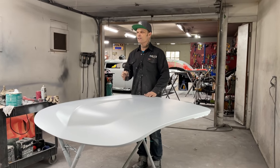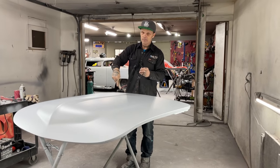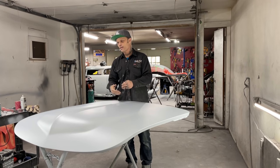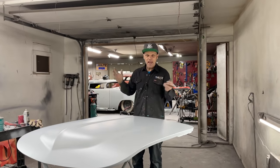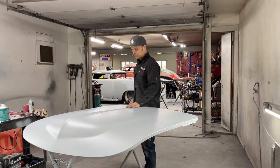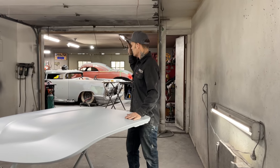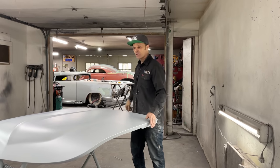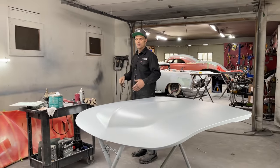And this is the reason why I feel like it's okay, because I may as well explain it to you. When I look inside the can, that's what's left over, and I've broken it out a few times, and nothing happens when it's that thick. It all goes together, nothing happens that I've ever noticed, and I take notice of that stuff when I'm applying it. People say we have to give it time to adhere or time to flash off or whatever. Well, the stuff I leave in the can does not have time to flash off, and nothing happens to that. So why would I think anything would happen to the top of the hood? I want to put it on there before it goes bad.